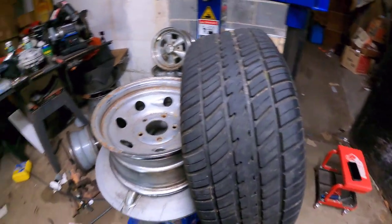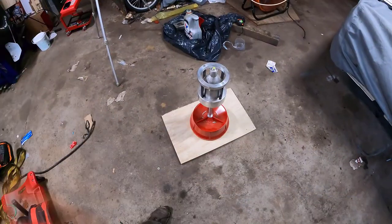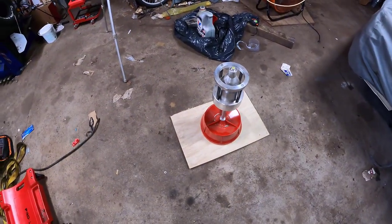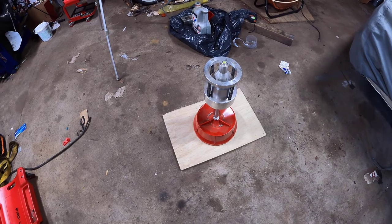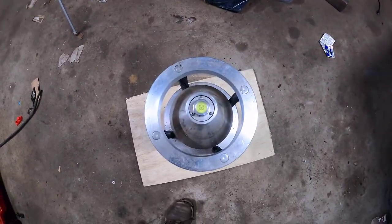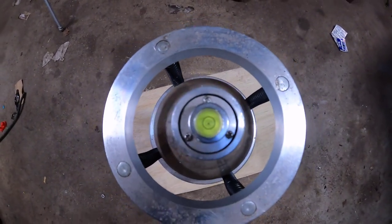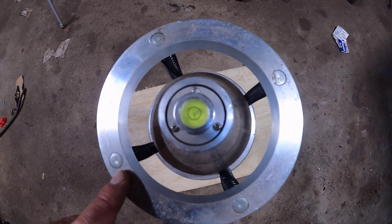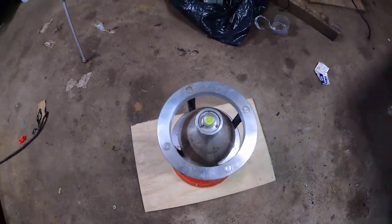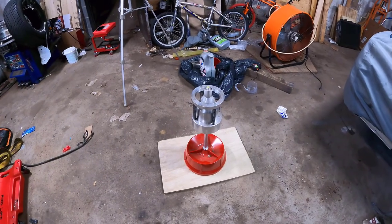So that's it - that's how to remove a tire. Next step: installing a tire. Also, we'll look at wheel balancing. For wheel balancing there are many ways to do it. The right way is probably with a modern digital balancer - I have one, I just never wired it up. So instead I use my trusty Harbor Freight cheapy wheel balancer. That actually works just fine. For 15-inch wheels it works fine. If you start talking low-profile stuff, not so hot.